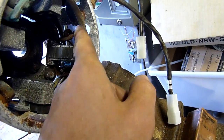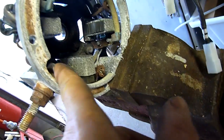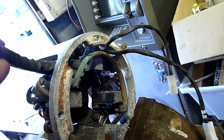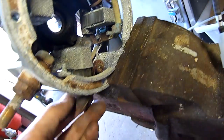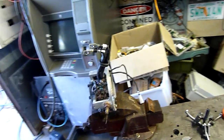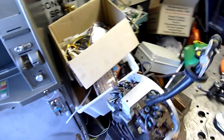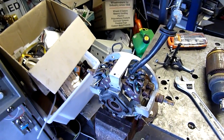There's that ring I was looking at inside. You've got one stud there connected to these two, and positive and negative — and you've also got this one here connected from one side to the other. No idea what that's connected to — it was floating around inside when I got it. Some of that monitoring stuff can pretty much go. I'll make my own controller, get rid of the module — I don't need its own specific controller. I just need some good 250 to 400 amp contactors and to clean this poor thing up.